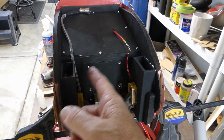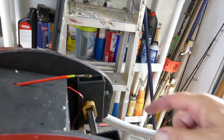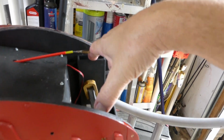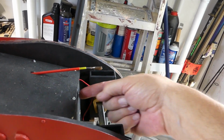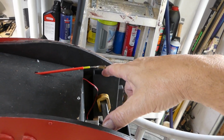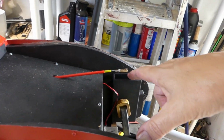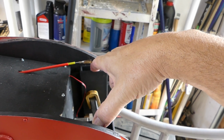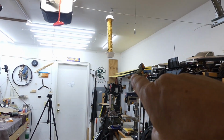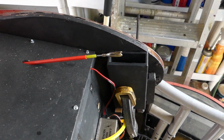So we are good with where these things are located, and that little bit of extra standoff puts the majority, the mass of the weight, right here in the middle. So that's about 1.5 inches farther off than the firewall. Remember, 5 pounds on the firewall line, right about here, 5 pounds. So 3 3/4 pounds right about here should be good. We're going to find out when we get those wings back up on the plane and we take it outside for a weight balance.